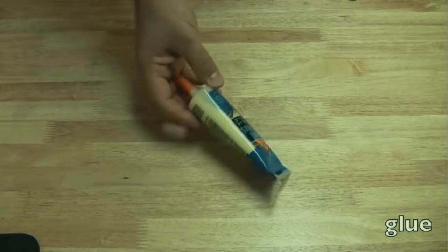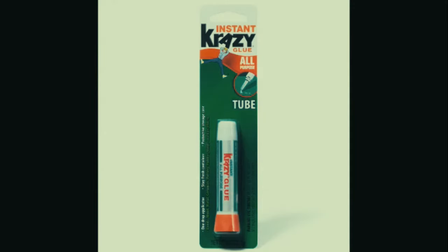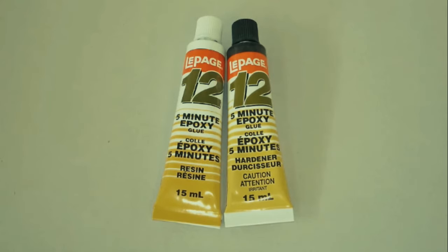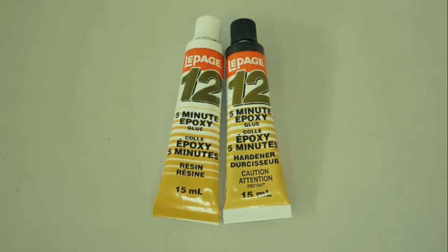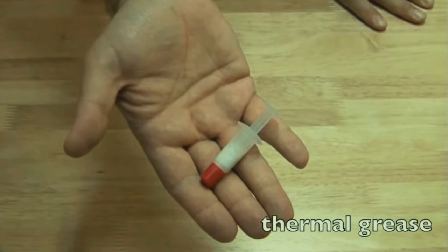For glue, I use crazy glue mainly. Crazy glue is great for attaching plastic to plastic, and a lot of laptop repairs are just dealing with plastic - it's cheap and available everywhere. When you need a stronger bond, try epoxy. They make a five-minute epoxy that dries quickly - I recommend letting it sit overnight. Epoxy requires mixing two tubes, smells strong, so be in a ventilated area.